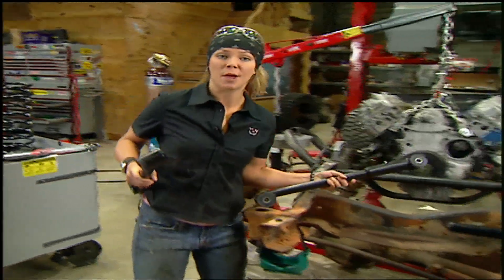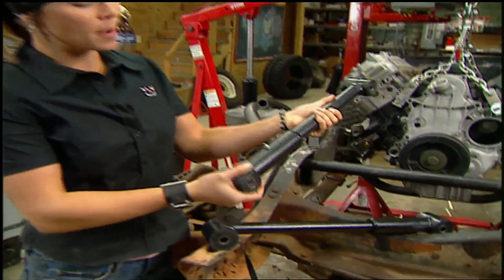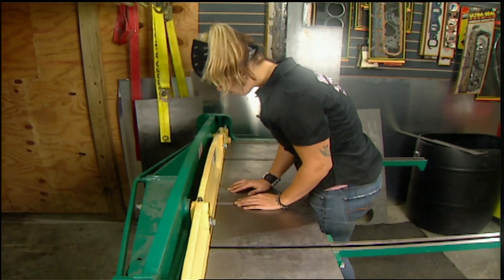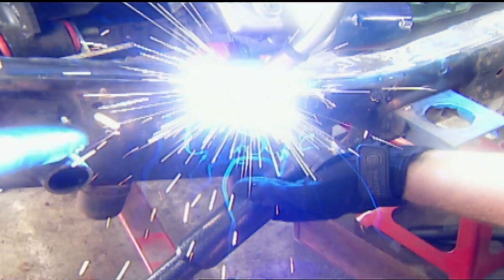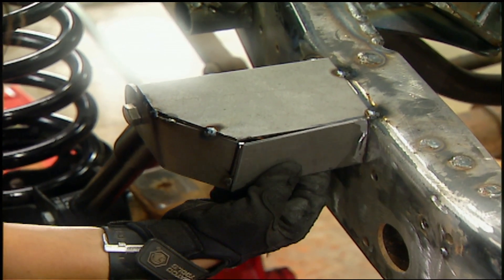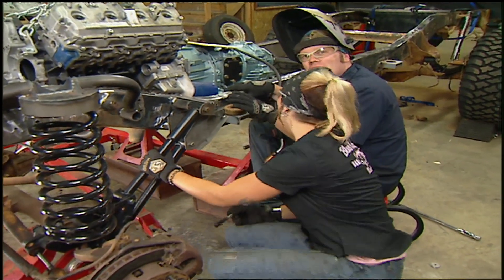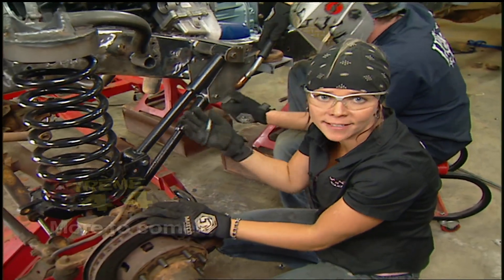Now that the spring buckets are taking shape, we can go ahead and start locating the mounts for our trailing arms using the measurements we got off that Dodge truck. The nice thing about Rough Country is that we can be using these arms for a lift anywhere between 2 to 8 inches. When custom building any kind of mount for a suspension component, it is a good idea to box it in for strength, as well as add gussets from the mount to the frame. Overbuilding a mount now with a little extra material will lessen the chance of it breaking later. With everything held in place with some good strong tack welds, we can turn our attention to the passenger side of the truck, lower it down on its wheels, and if the ride height looks good, we can finish welding in all the brackets and the buckets.